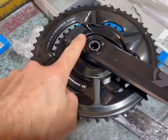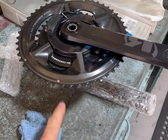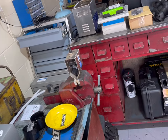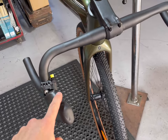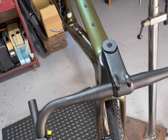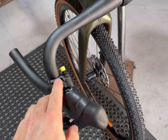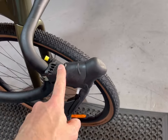So we've got that all assembled and tightened up to 35 — a bit over 35 newton meters — so that's all good to go. While we're still waiting for the battery to charge, I'd like to connect it up and just make sure that the shifters and all of that is connected and working before we install it on the bike. But in the meantime I've gone ahead and started putting the shifters on, and I think the next thing I'll do is run the hydraulic lines and get the brakes all set up. I've just put them on using the markings in the bar as a quick guide, put the bike on the ground, and checked that we're happy with where the shifters are sitting.